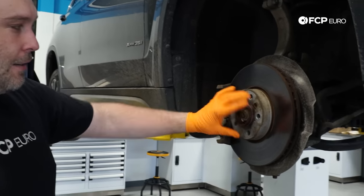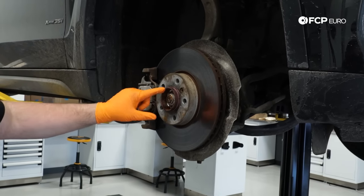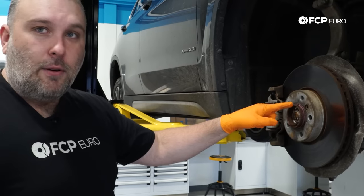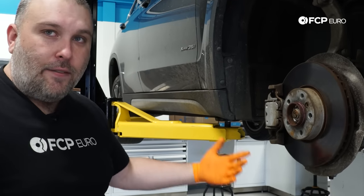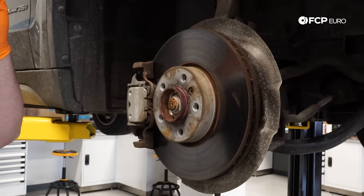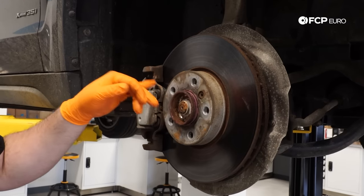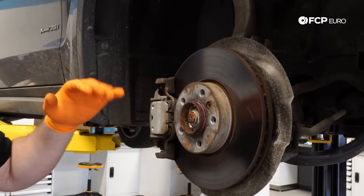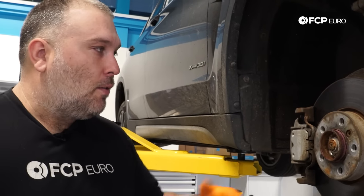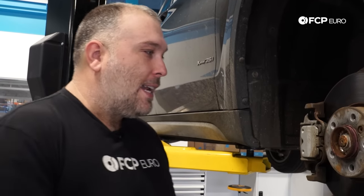It's really good to go in there and clean it off, which we're going to do during this brake service anyway. If your wheels are not coming off easily it's because of galvanic corrosion between the aluminum wheel and the steel hub — clean it off whenever you have the chance. On this vehicle the front rotors were machined and front pads replaced at some point, but the rear brakes need replacing. I'm just doing all four corners to start fresh.